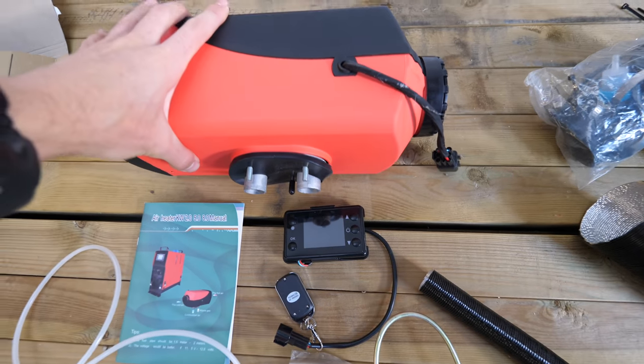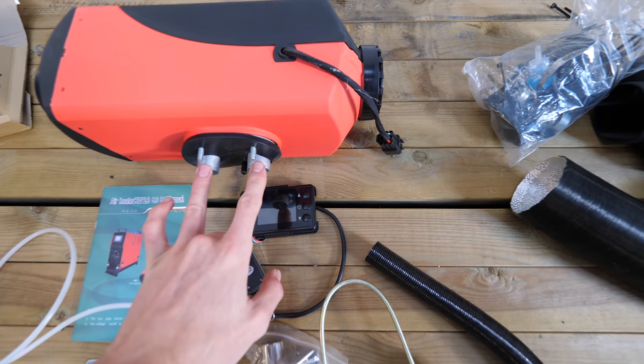T5s and T6s almost have the whole system ready to go for a diesel heater. There's a marked point on the top of the fuel sender that's a great spot to drill through to install the fuel pickup. They even have extra tube clip-in points along the tank to keep the fuel line secure and tidy. So T5s and T6s are really nice to fit a diesel heater to — though I totally understand some vans are much trickier, and I get why people go for a separate tank.